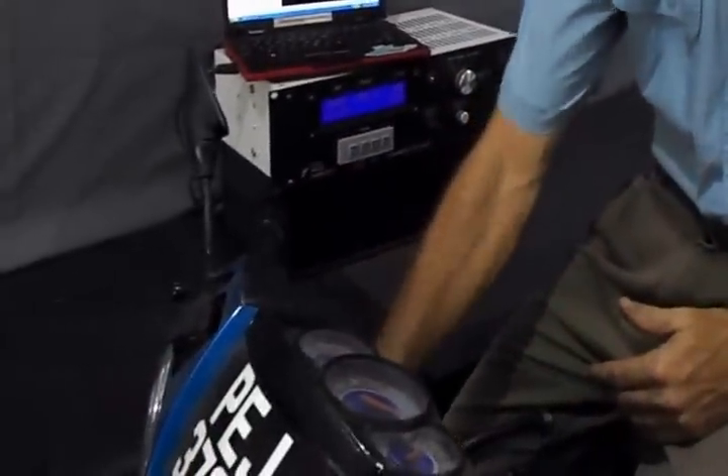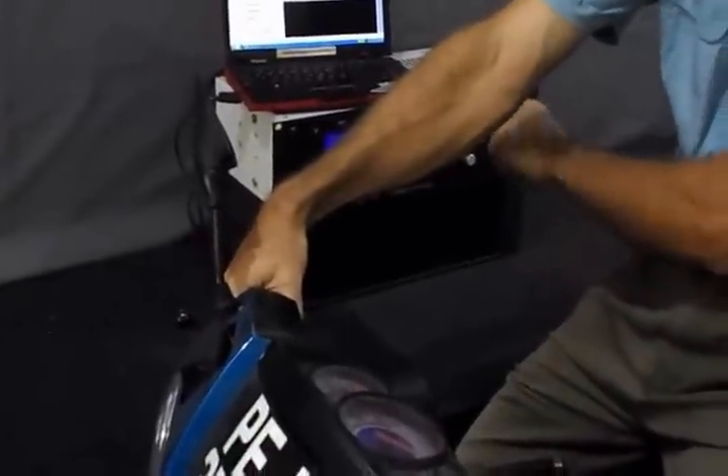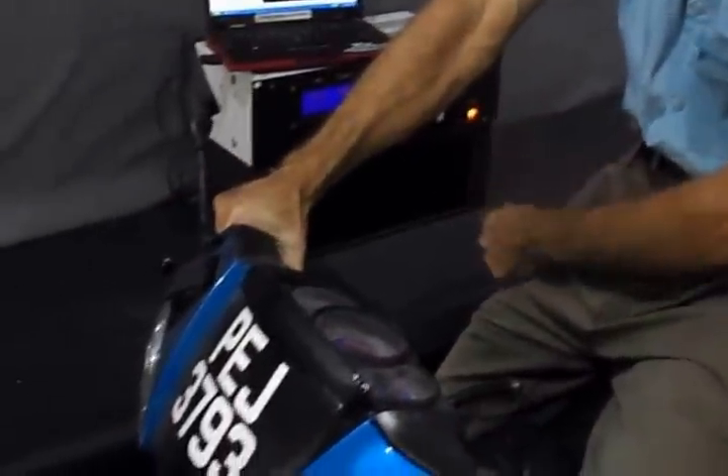The motorcycle is now mounted to the chassis dynamometer. We'll operate in speed control mode at 50 kilometers per hour. I'll increase the throttle and the torque will increase, but the speed will maintain steady. At 50 kph, I'll begin reducing the speed set point until the clutch slips.